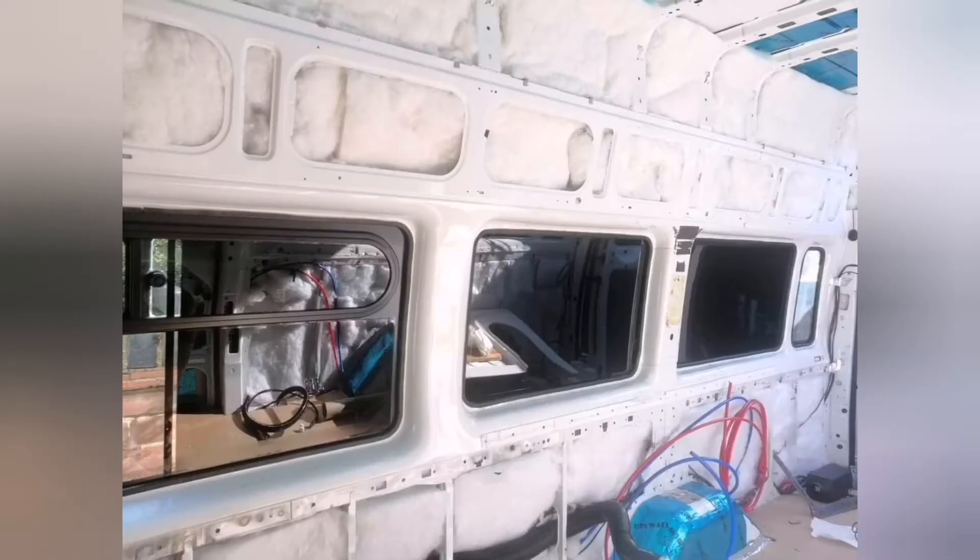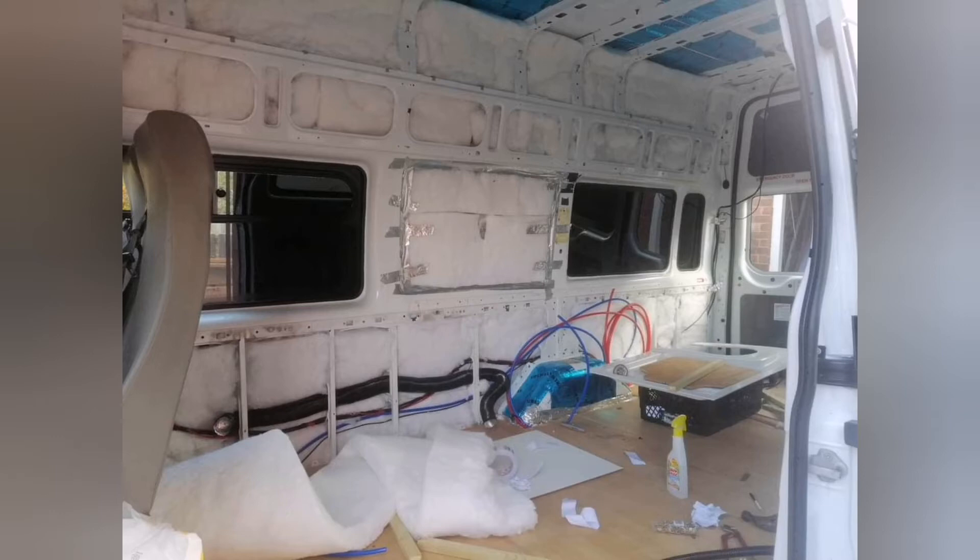Back on insulation — there's a lot of glass since it's a minibus with many windows. Windows are horrendous for insulation: they let heat in from the sun like a greenhouse and let heat out in winter. I used blackout vinyl film on the windows that won't be used — they'll be behind the shower cubicle and a foldout bed. I filled the window cavities with the same recycled bottle insulation, fixed with spray adhesive, and sealed around the edges with aluminium tape for maximum insulation.